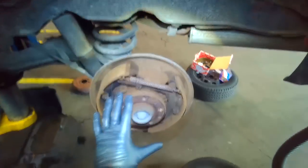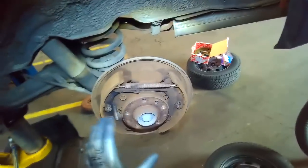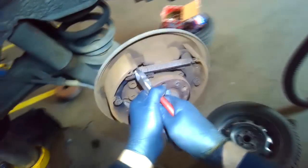When you're doing rear brakes, do one side at a time. That way you can look at the orientation of everything on the other side if you happen to not remember how things go back together. It doesn't really matter what you take off first or how, just as long as you get it back together the same way.